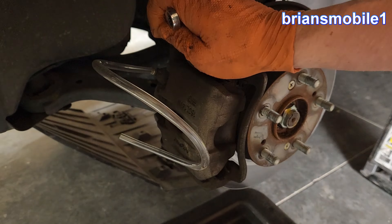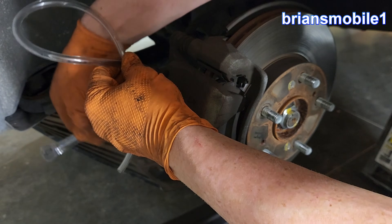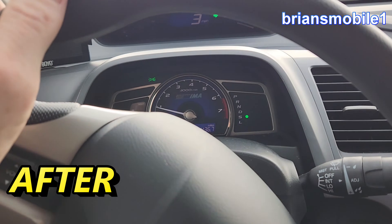I've got all the wheels off, do a pigtail — curlicue, whatever — and what that does is it keeps the air going up the line. It's like bleeding it conventionally worked. I've got my foot on the brake and we're not beeping. Now that's more like it. Looks like we've got a fix.